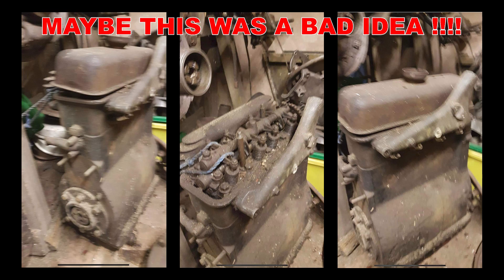Morning guys and welcome to Lord C's Garage. Today I'm super excited and a bit nervous. As some of you may have seen, I bought a 1932 Singer engine that's been sat for about 30 years and is basically very rusty. When I stripped it, the block had a number of cracks in the top. Being a cast iron block with particularly poor castings from Singer, the only solution is to cold stitch it — sometimes that's possible, sometimes it's not. The block itself is very thin and lightweight as it formed the basis for a Le Mans car. So I'm off this morning to Burton-on-Trent to hopefully see the guys resurrect it and make it usable, put it in a car, and drive it.